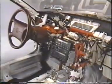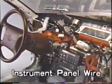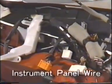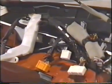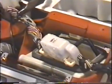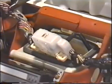This is the instrument panel wiring harness. It is connected to the combination meter, rheostat, mirror ECU, luggage compartment door opener, remote control mirror switch, wireless door lock main switch, air conditioner control assembly, radio and tape player, junction block number 3, etc.